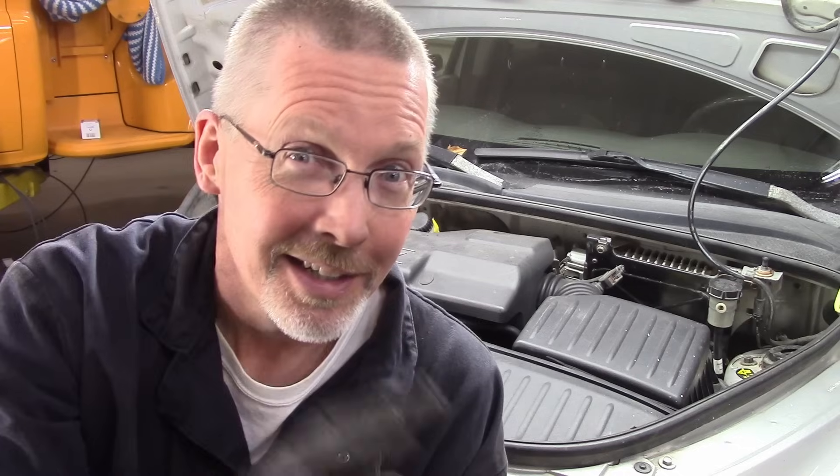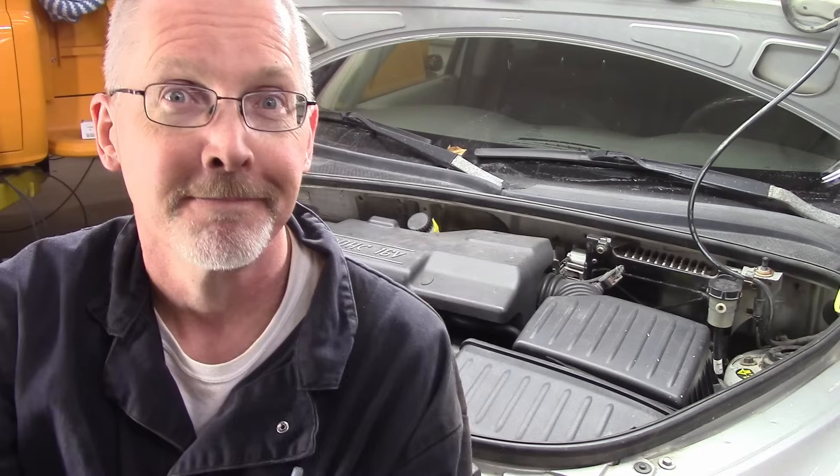Before you jump into any kind of repair on a vehicle, you want to really know what is wrong with it and what's going on. When I did the timing belt on this — check the video link up here — one of the things you have to do is split the AC system to get the timing belt out. Thank you, Chrysler. You're supposed to have a refrigerant recovery system that collects all of the stuff, so it doesn't float off into Never Never Land and put a hole in our ozone layer. This system was largely empty, so there wasn't anything in it. Once I got the timing belt all back together, I need to recharge the AC. It was not charged to begin with, wasn't operational, so I want to find out why.